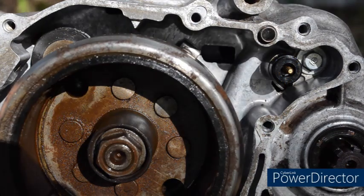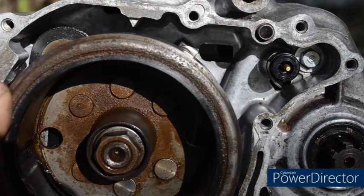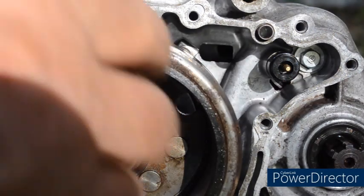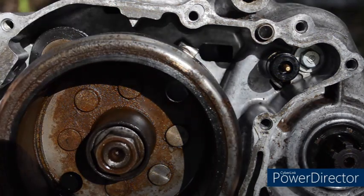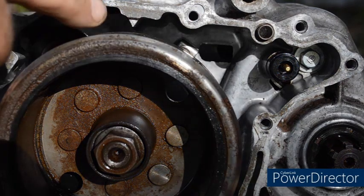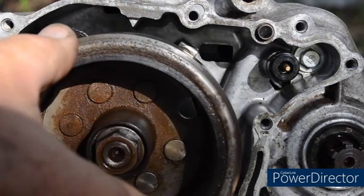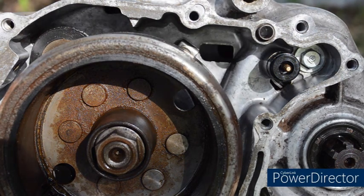It's still not that easy to see, but we'll have a good look. As the piston comes to the top of its stroke, we get to some timing marks. First of all there is an F and the actual fire mark is there, and then slightly further around there is another mark with a T which stands for TDC or top dead centre. So with the mark next to the T in line with the pointer, the piston is at the top of the cylinder or top dead centre. As the engine rotates and the F aligns with the pointer, we get ignition.